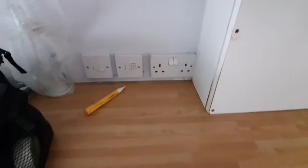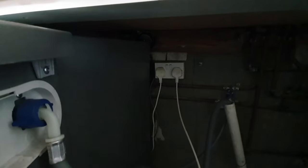The next thing to check is obviously the fuse in the plug. I've pulled the machine out and underneath we have a socket which you can see has got power. Testing the cable of the machine, we've got power, which means the fuse in the plug is okay. So we know we've got power coming down through the cable.